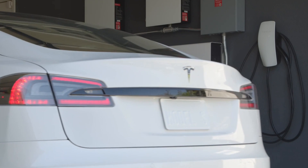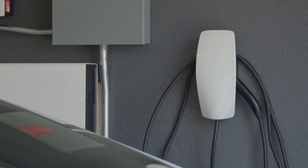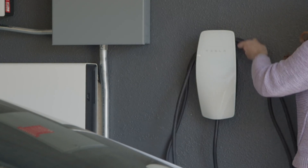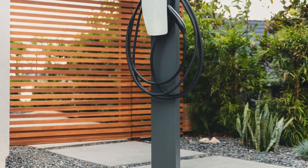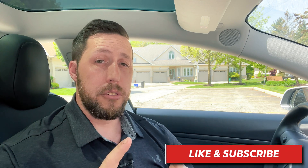The other advantage of the wall connector is it's a hardwired installation. It has a thicker gauge cable and is designed for indoor or outdoor use, which can handle more extreme temperatures — like extreme cold where I am, or extreme heat if you're in California or some desert places. Some say the mobile connector isn't meant for daily charging, but I've used mine now for two years with no issues. I have the kit in the garage and run the cable underneath the door to the car. Make sure you have a rubber sealer at the bottom of your door so you don't damage the cable. If you're using the mobile connector every day, unplugging it every day, leaving it in rain, cold, or snow, it can wear out over time.